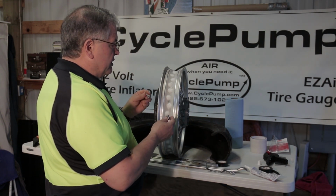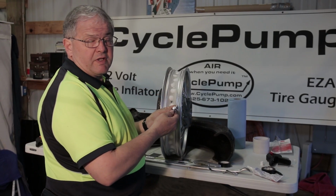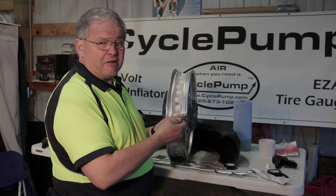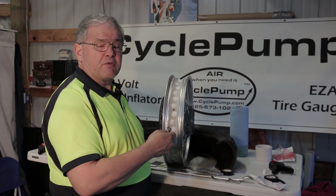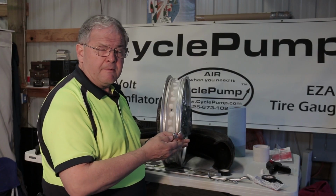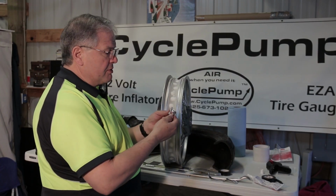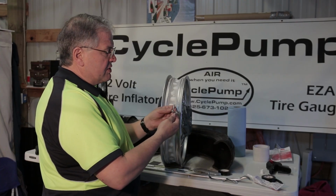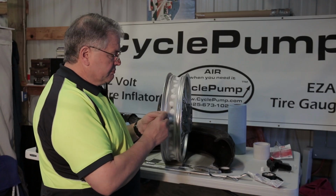At the beginning of the video I talked about valve stems. Most tubeless valve stems are about a 10.5 millimeter hole. We didn't want to drill a bigger hole because if we ever have to put a tube back in for some emergency, we don't want to have an oversized hole. So we ordered special valve stems that are 8 millimeters all the way from top to bottom.